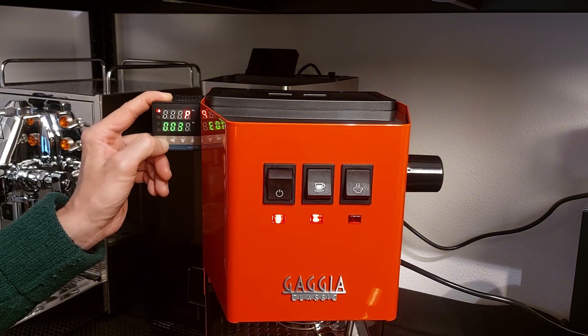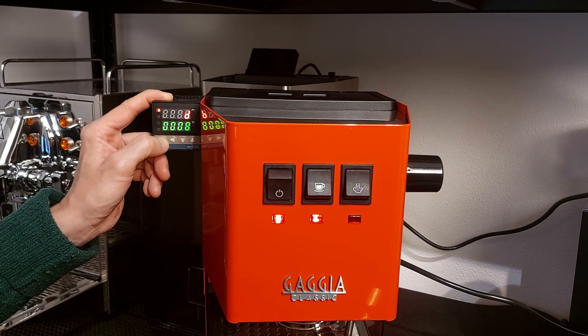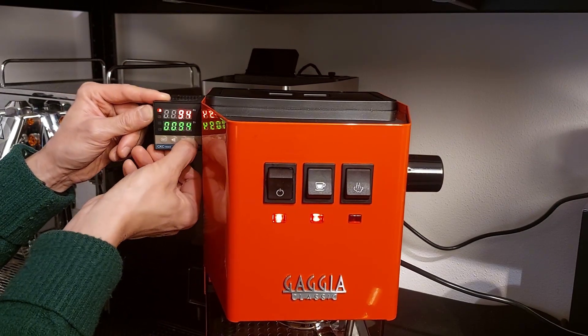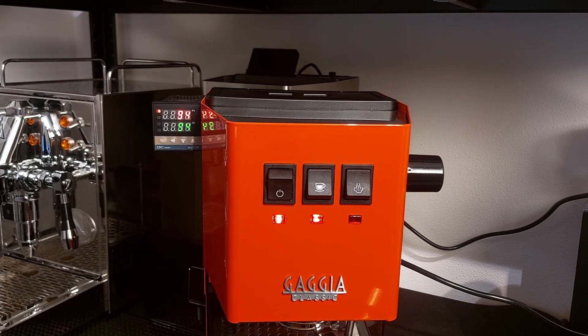When you press and hold and keep pressing Set, you'll see the P — in my case it's 30; the I is 360; and the D is 8. To adjust your desired temperature, just press Set and use the arrows to move between digits, then increase or decrease. These are the basic settings. For more details, I'll leave a link in the description and a card here for my previous videos about adjustments in the Rex C100 and the XMT.